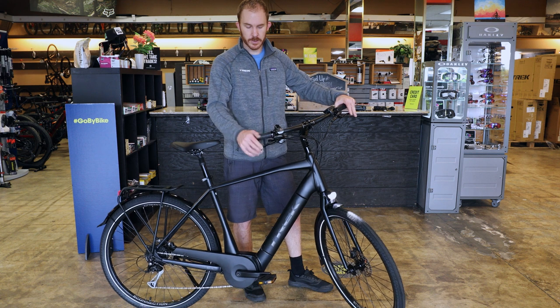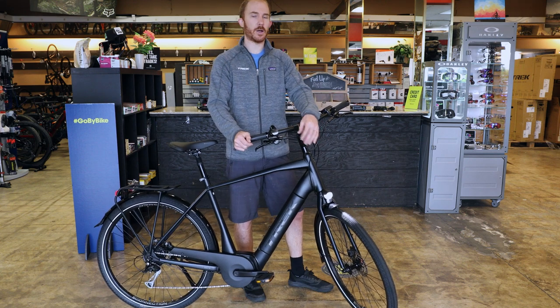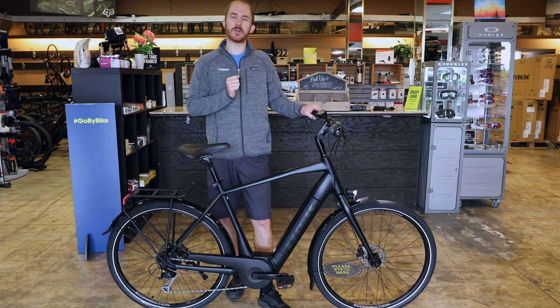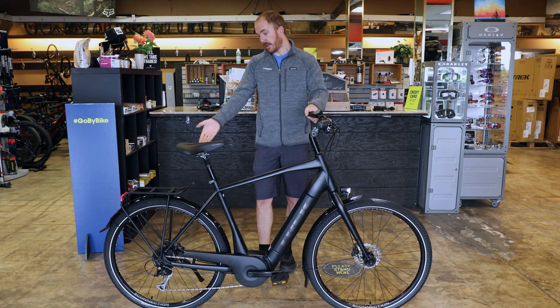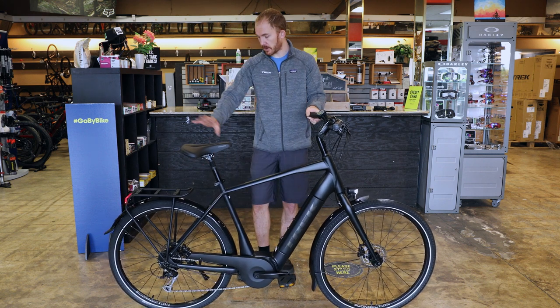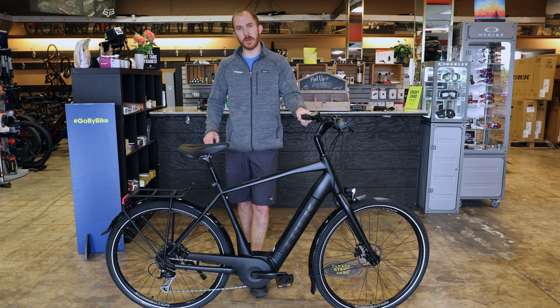Regarding the brake system, these Shimano hydraulic brakes are super powerful. They use mineral oil and are very low maintenance, but you do have to pay attention to pad wear. When you come in for tune-ups, the mechanic will look at the bike and recommend service. If you're riding a ton, visually inspect the brake pads yourself to make sure there's still some material left — once you get down to the metal you can easily ruin the disc brake rotor. Also, never touch the rotors or get oil on them; be very careful when applying chain lube so you don't contaminate the brakes.